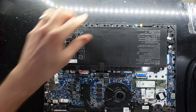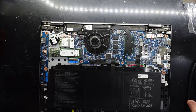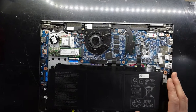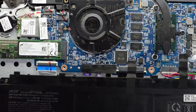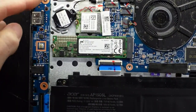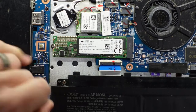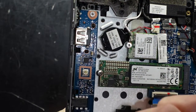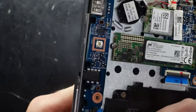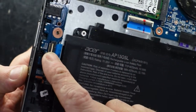Sadly looking here, there's really not that much we can upgrade. Looking at it from a repair standpoint, if I zoom this in — over here we have a daughter board, which also looks to contain the battery reset button. On that daughter board we have HDMI, a card reader, headphone jack, volume up, volume down, and battery LED and power LED right here.